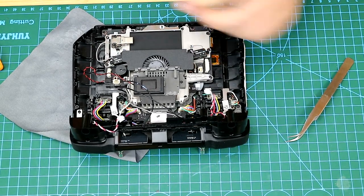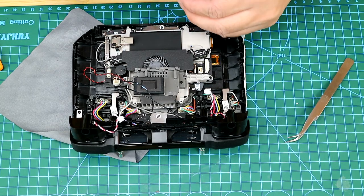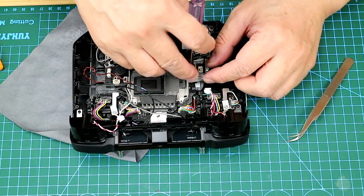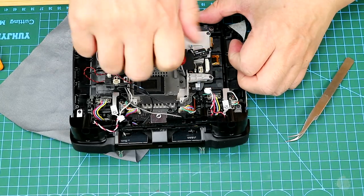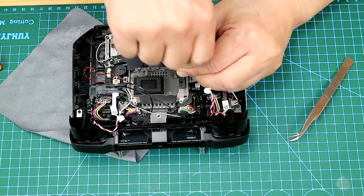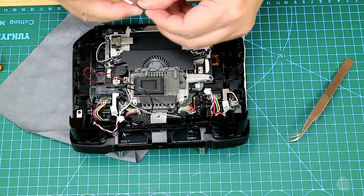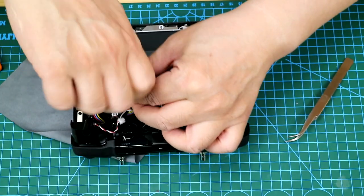The OcuSync system of the RC Pro adopts the technology of MIMO, multiple input and multiple output. There are four antennae, which are meant to boost the input and improve the efficiency of signal transmission. Its disadvantage is that it's not anti-interference, especially in high interference areas. So combined with the ALIENTECH signal boosters, its anti-interference function can be deeply improved.